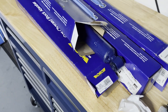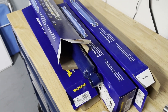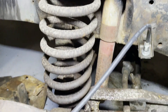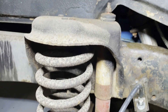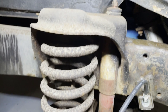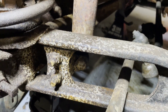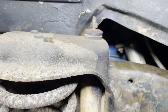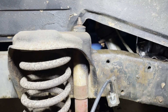Anyway, the shocks are old so this is gonna be a quick video of swapping them out. You can see these old red ones that look rusty and nasty — they don't seem completely blown out or anything, but I figured why not while we're here. I already busted that top nut loose. Down here there's a bolt on the bottom, so that's what we've got to do on the front ones — take those bolts out, pull these suckers out, and put the new ones in.